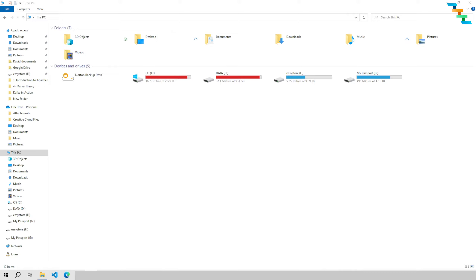The only solution I have is to extend to a bigger SSD. In that case I need to clone all the content, because it also has activated Windows and a lot of other activated software. Completely reinstalling all those things is not easy, so I'm going to clone the existing SSD to the new SSD. That way I will get all the software I currently own, plus the extra space.